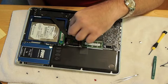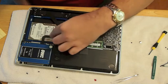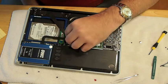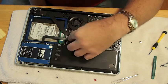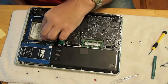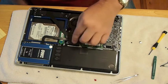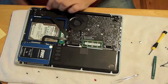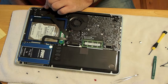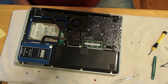You can see right there we're putting that cable in — here's the SSD cable I was telling you about. You need to make sure when you put those down to be very careful, because those pins could be damaged if you get one of them crossed up and mash it down in there hard. They go in real easy, so if it's not snapping in just right, then something is not going in the way it should be. But overall, this is not a bad install — I do recommend it. It's an awesome upgrade for anybody wanting to improve the quality and speed of their computer.